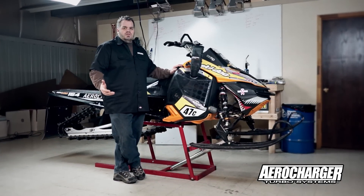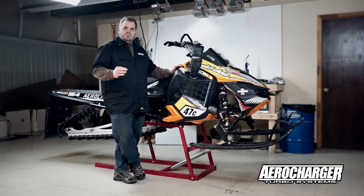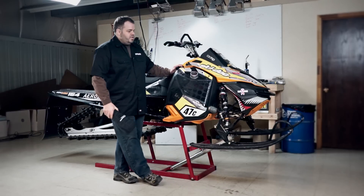With our system you're going to go from 239 to 256 horsepower and have a more consistent running snowmobile. This system is available — it's not included in the kits — and for the right customer in deep heavy snow, this will give you zero vacuum on the compressor. You'll maintain good performance day in and day out, and come springtime you could remove the snorkel if you're in hard pack snow.